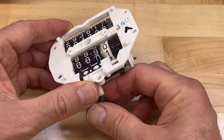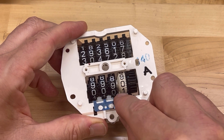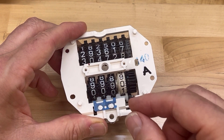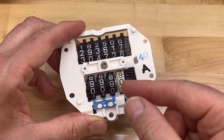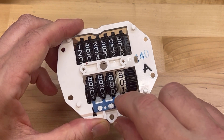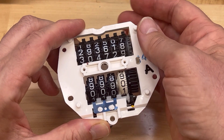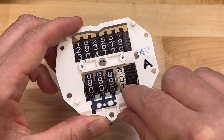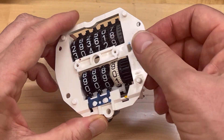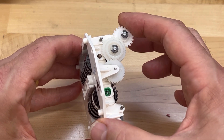It is possible when you reset the trip meter for the little gears to get hung up down there, right where it has a little pickup to move the tumbler to the left. So it goes around one time and then moves this one notch. There's a little pickup down in there, and if it gets trapped on the wrong cog down there, this can happen where it'll jump like that, and that little gear is essentially stripping against these gears. In theory, that would add more pressure to the odometer gear — maybe be the straw that breaks the camel's back.